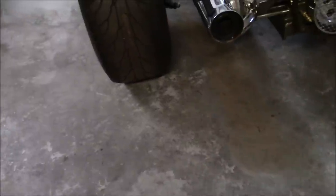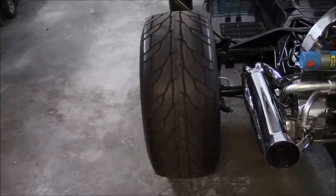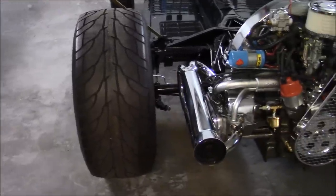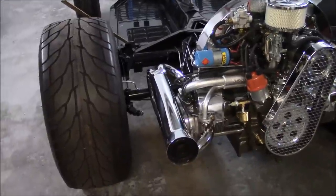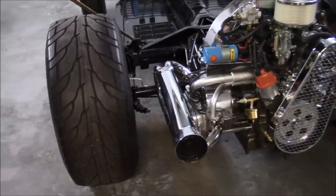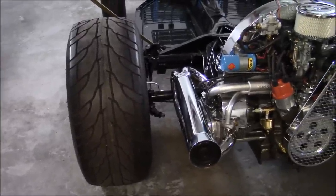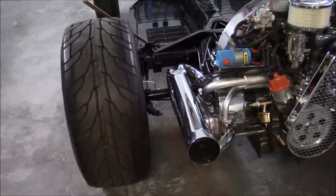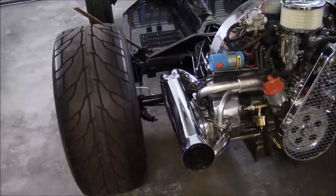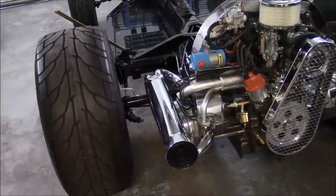The factory wants a little bit of positive camber in the rear wheels — that's where the top of the wheel is out a little further than the bottom. They want the axle tubes pointing down a little bit at the outside. What that does is keep the wheel bearings out in the wheel area lubricated. When you see swing axle vehicles that are slammed and the axles are pointing up as they come out, they're not getting any lubrication to the bearings — it won't be long before they have to replace them.